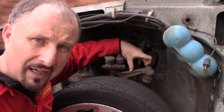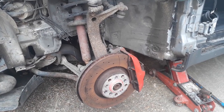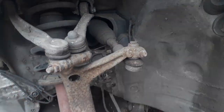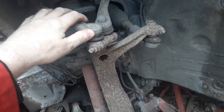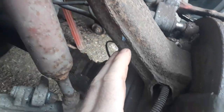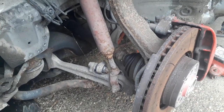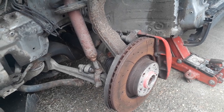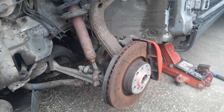That meant it was never going to be able to be bolted back to the original location on the Audi A6. With the wheel removed we can have a closer look — the steering rack is quite high up, you've got all this extra suspension stuff which would foul the bonnet on my supercar. And then if we take a look at the hub carrier itself, we'll find that it's all one piece — it's not really something you can cut apart. I was also trying to develop a kit, so I didn't want people having to chop into Audi A6 hubs to build my kit. So this was never going to work.